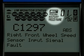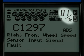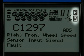These four icons show the status of the malfunction indicator lamp or MIL status, if there are any pending codes, the code history and the freeze frame data. The numbers highlighted here show you how many diagnostic trouble codes you have and the order in which they were set by importance. The G and M icons signify whether the code set is either a generic or manufacturer-specific code.